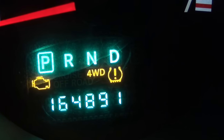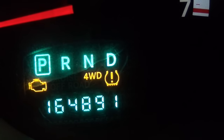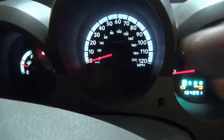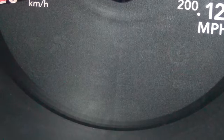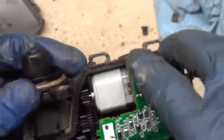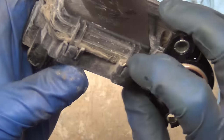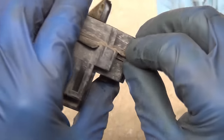We'll zoom in here. I'll turn it back to two-wheel drive. Two-wheel drive's easy. All it does is it just pushes that little button in and out — it's happy now. It went into four. But the thing is, if the light's staying on and you unplug that little actuator — that's all they call it at the dealership, just the actuator — if that light's staying on and you unplug it, it makes the light go out. So I think all the logic, all the control, everything's in that one little unit. So we're on the bench. It's gonna be a little tricky to take apart. There's a lot of glue involved. These all buckle together to hold it until the glue dries.